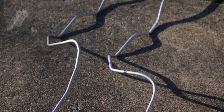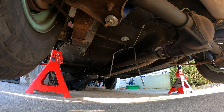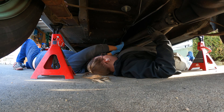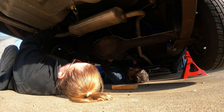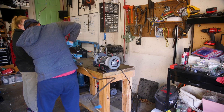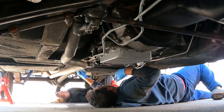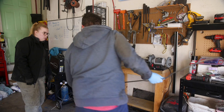The line was bent and it looked pretty close to the previous one. But now that it's bent it's time for the real test — to try and get it back under the car. It didn't take long before we realized we had a few issues. It not only needs to go this way, we need to bring it away from the drive shaft — it needs to rotate. The bigger issue is that with a softer metal we could probably bend it while it was installed, but with stainless any little corrections mean we have to take it out, bend it, and try again.